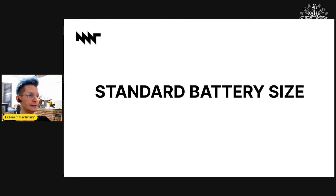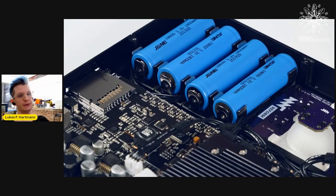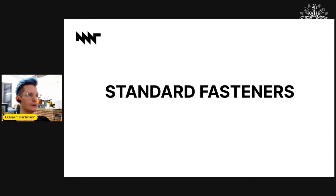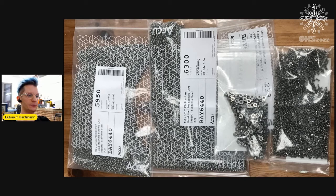Standard components like batteries. We didn't want people to rely on us to source and replace batteries, and we wanted to make sure no one would put themselves in danger experimenting with lithium-ion cells. So we picked the safer lithium-iron phosphate chemistry, also called LiFePO4, and decided to go with the standard 18650 form factor. This way Reform owners — but also we as the manufacturer — can pick from a wider range of suppliers that offer the standard format, which is very good in the case of shortages. Standard fasteners too: instead of requiring special custom screws, we use standard M2 screws almost everywhere in the device.